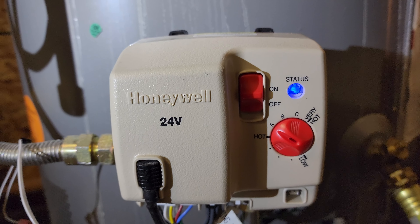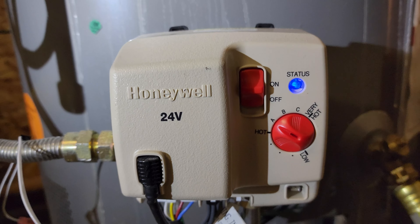That reset it, like it says in other videos. That's when you start getting the heartbeat flashing LED - the blue status light. As soon as that happened I could hear the igniter clicking and the water heater turned on. It's currently heating the tank back up. It was a very simple temporary fix with just these two resistors.